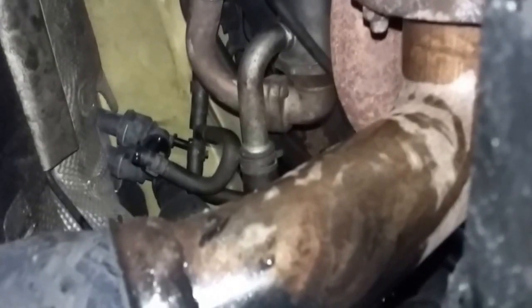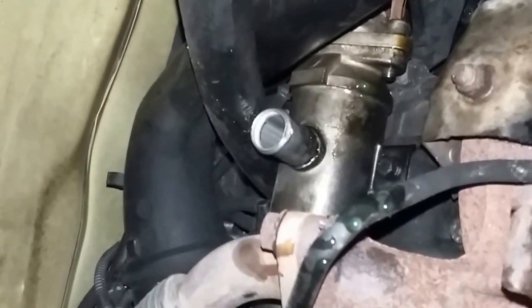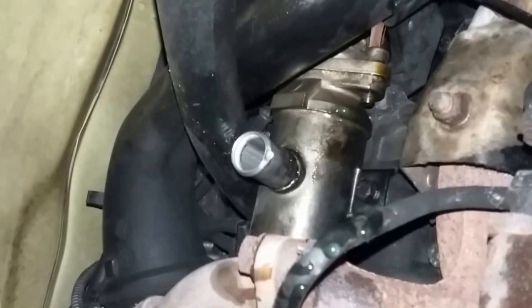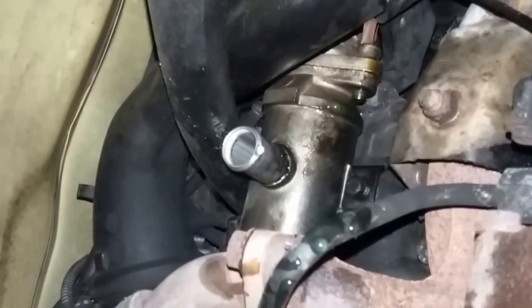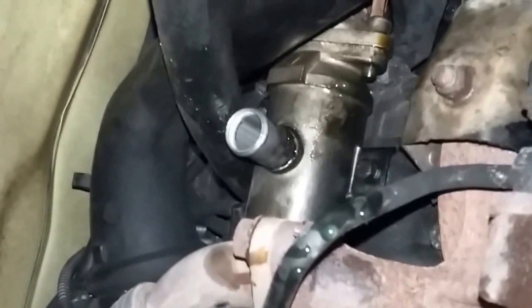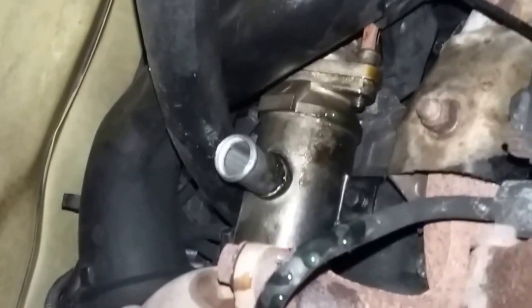If you look up there, you can see way up there where that hose attaches — where it goes into the firewall for the heater core. It came over, over, over — where you can't really see. But there you can see where I'm taking it off; see that nipple right there where I removed it, and the actual hole in the hose. The hole was on that far side where you could not see it, and right up against that other hose, where the other hose was acting like somebody putting their finger on the hole — so it wouldn't leak unless it was really under a lot of pressure after the engine was at full operating temperature for quite some time, and then it would finally start leaking out.